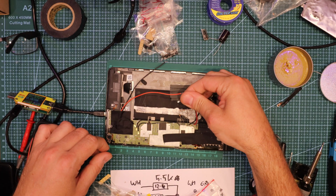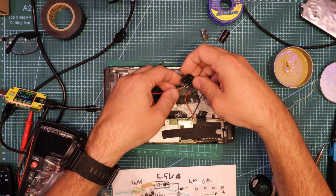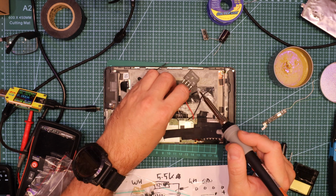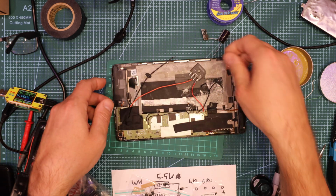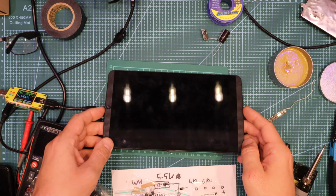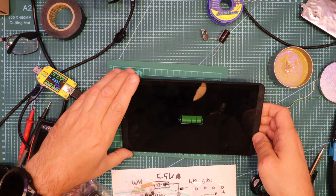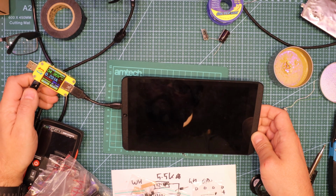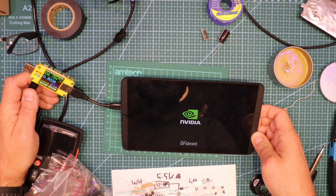The diode is very hot, but we are getting closer and closer. Okay, I just put in a big 5 amp rectifying bridge, which has got 4 diodes inside, so I'm gonna use just one of them. All right. Okay, it shows battery fully charged. Okay, it takes half an amp. 0.2, 0.3, 0.8 starting. Alright, we've got the NVIDIA logo.